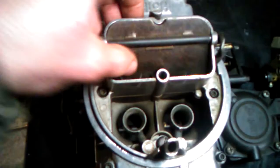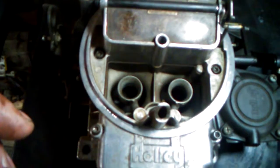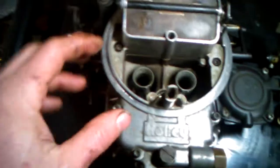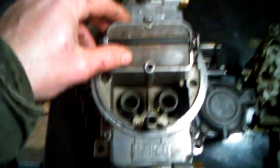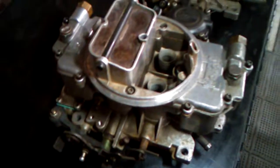If you put that carburetor on a heated intake manifold, the fuel immediately vaporizes because the droplets are so small — the heat just turns them into gas. That gives you less volumetric efficiency and less power. That's perhaps one reason why this style of carburetor isn't popular anymore; Holley no longer makes it and sold the rights to manufacture it to Summit.